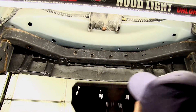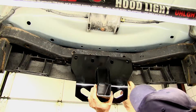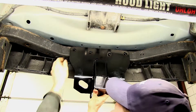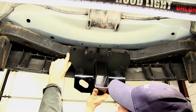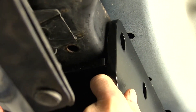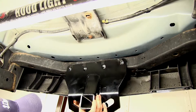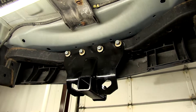Now we'll go ahead and take our hitch and put it in position and do a test fit. When we do our test fit, we want to double check for the gap between the hitch and the bumper structure. It does come with some washers if you need to take up that gap — it's going to be trial and error. We'll use some tape to help hold the washers in place while putting it back up. Now reinstall the hitch and install the hardware. The kit does come with extra washers if you need to take up more gaps.